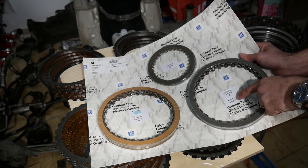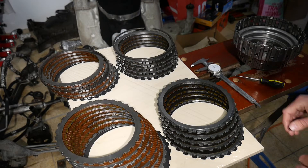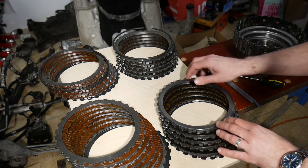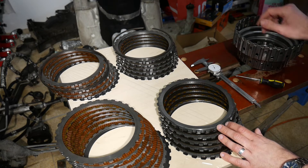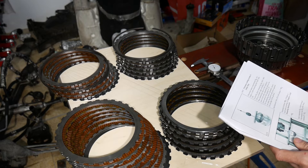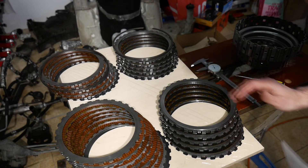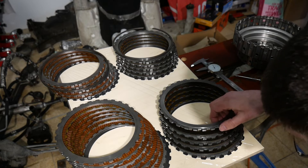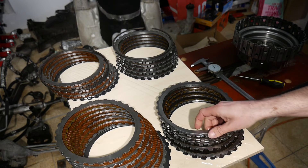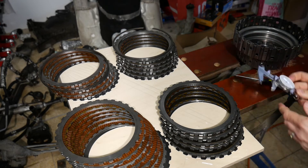Here are the new frictions. As you can see, couplings A and D are different in color compared to couplings B and C. So if I'm searching for the old C frictions, I have to search for the gray ones — those are here on the right. But both of these clutch packs come with five steels and four frictions, so there's no way to figure out which belonged here. To make it more complicated, the manual refers to the C clutch as having five linings — five frictions — while both of these only have four. So obviously this was changed later in production. However, this steel here is extraordinarily thick, so I suspect this clutch pack could be equipped with one more friction if necessary.